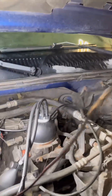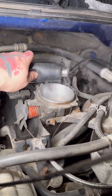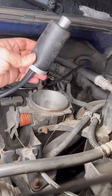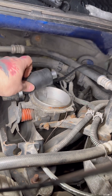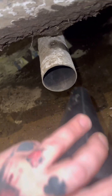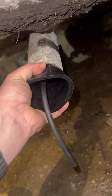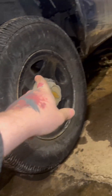Might be running low on oil now — deflate. And boom, you can see this throttle body has this extra opening right here, which was making it hard to seal. Put it on again, pumped it back up, and got it. You want to be very careful with these bladders — watch out for any sharp objects on the throttle bodies, make sure they're clean before you use them so you don't puncture your bladder. But you can always get more bladders — it even came with a spare in the package. For exhaust leaks or evap leaks, you shove this cone in there — it's real rubbery so it'll smoosh in good — and then you can follow wherever the smoke is on your exhaust.